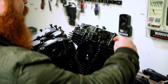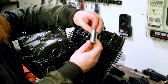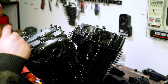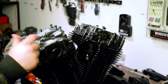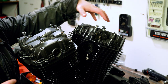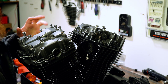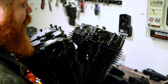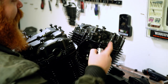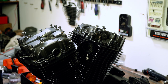The first thing you're going to need to do is remove the spark plug from the rear cylinder. If you don't know what size socket you need, it is an 18mm socket. It's also a good idea to remove the front as well — you might as well remove both. Make sure that you haven't got anything in any of the exhaust or intake holes covering them up. This is the time to remove all your towels and rags, because we need there to be airflow while we're doing this. Remove that rear spark plug, 18mm socket, and we can move on to the next step.